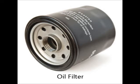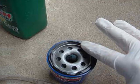Step 5. Replacing the oil filter. It is the exact opposite of removing the oil filter. Grab the new filter out of the box. A tip that I have is to use some of the old motor oil from the old filter and lubricate the new gasket on the new oil filter by rubbing around the black O-ring. This will ensure a tight fit around the engine block and make sure that you do not have any oil leaks after you complete the oil change.